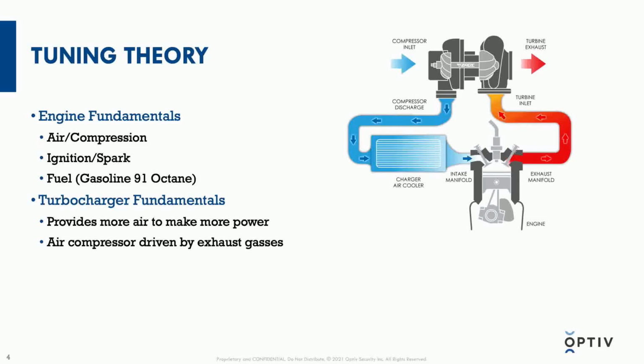To actually ignite that combustion reaction, you need a spark plug on a gasoline engine. It's possible to have the compression go high enough to ignite the mixture or to have other problems, but I won't go into that. For instance, diesels ignite their fuel by compression. So in this case, gasoline combines with air, and you need to combine it in the right proportions. That mixture of air and gasoline is compressed, and then the spark plug ignites it at just the right time.